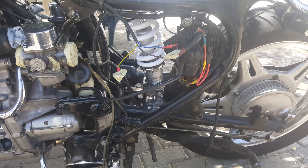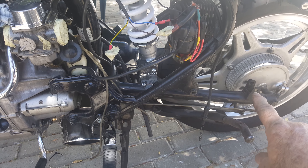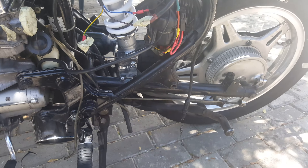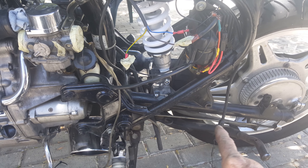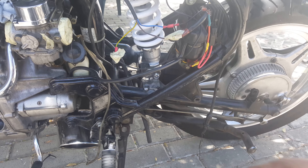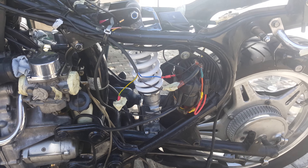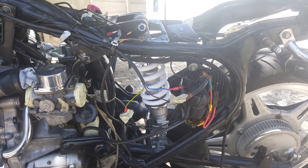I've let the rear swing arm go down another 50 millimeters, so it now takes up that 50 millimeters of initial sag. I think at this stage the spring is too soft. I'm going to get on the bike and she will then show you what happens.